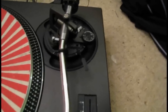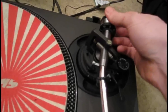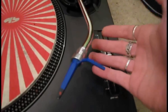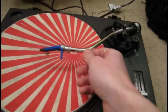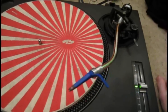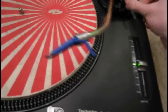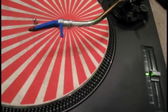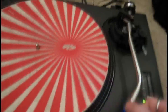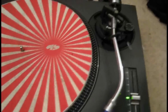You need to establish whether or not it's actually working. One thing you can do is to put your counterweight right back — not all the way back, but back enough just so that the tone arm will actually hover. Then what you should do is put it away from the rest, and then turn the anti-skating all the way around to number three, and it should ping right back to its resting position. Whenever you move it into the centre, it should go straight back there. But when you turn the anti-skating off, it should have no resistance in it at all. If it does that, the chances are it might not be working as well as it used to, but nonetheless it will be working.